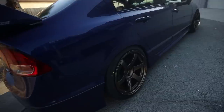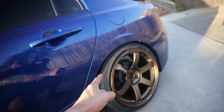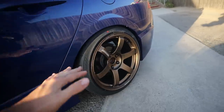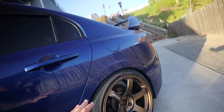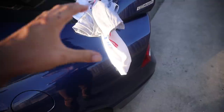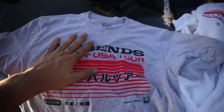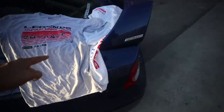Day two of the video and I had to take the Civic out because it looks absolutely incredible. We've got the fitment perfect on the car now with the TE37s and I had to come to a photo shoot with them because it literally looks exactly how I imagined it and how I wanted it to look. We dialed in the camber in the rear and the front and we also raised the car both in the front and in the rear about an inch or like an inch and a quarter. We haven't gotten an official alignment on the car yet so I'm not sure on the amount of negative camber that we have but I'm sure it's around like negative two-ish. The car runs great so I'm very, very excited about that.